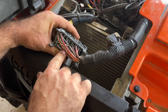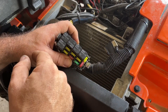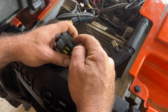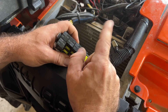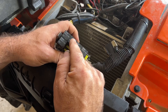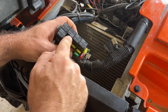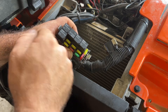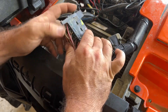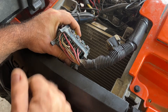Now we can access our wiring on the bottom for the relays. Basically how this works: you've got power from the battery coming in, power going out to the fan, and battery power coming in for the switch side. The ground is controlled by the ECM — the ECM sends a ground signal which grounds the switch portion of the relay, allowing it to click over and send battery power to the fan. All we're going to do is install a switch and jumper it into the ground control of the relay so we can turn the fan on and off with a switch instead of waiting for the computer.